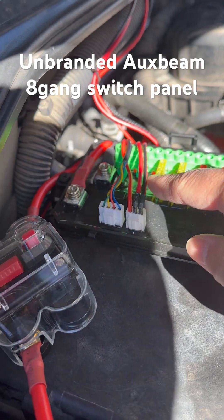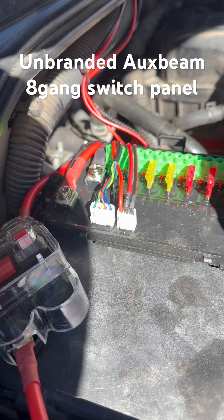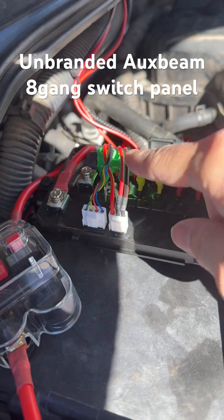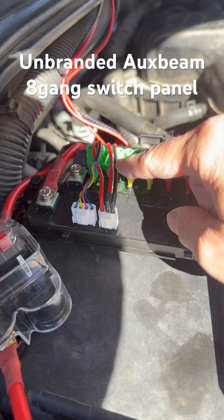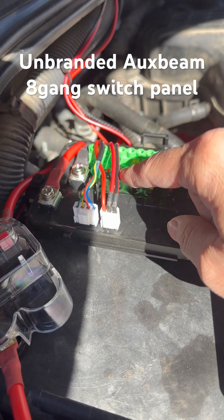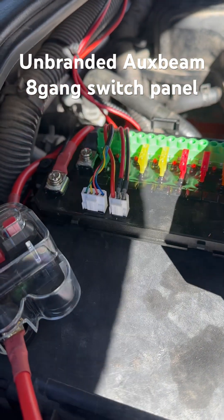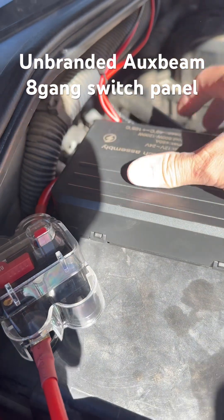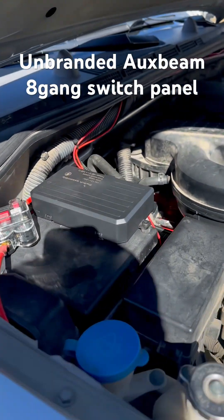I did it this way because every time I turn it on it will actually reset the brightness — if I turn it off it will actually forget it. So what I did was splice these two into one fuse tap into my fuse box, and every time I turn on the parking lights it will reset the brightness and it will illuminate inside the cab. That's how I did it.